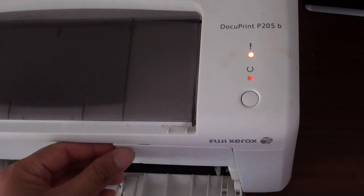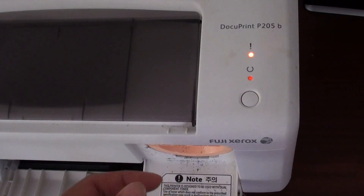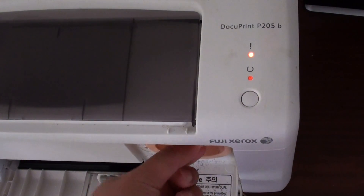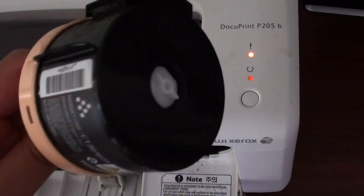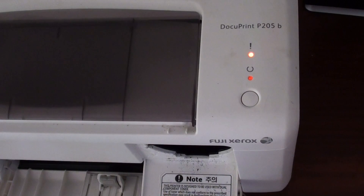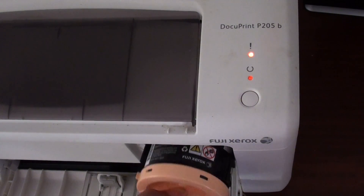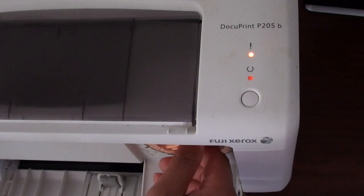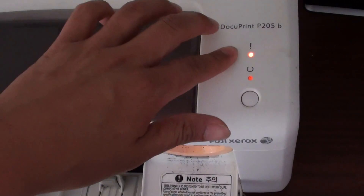At the bottom here you can pull out the lid and turn the ink cartridge anti-clockwise, then pull it out. Sometimes you can give it a clean or a blow and then try to put it back in. Make sure everything is cleaned around there, put it back in, then turn it.